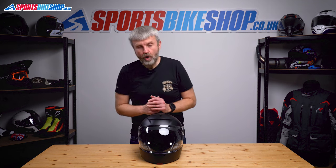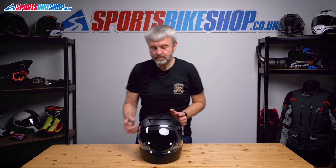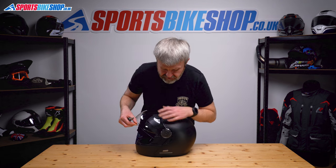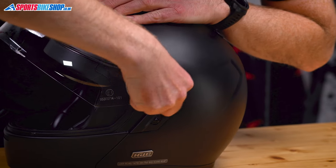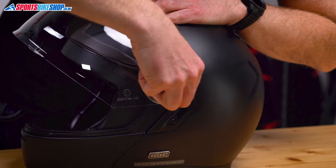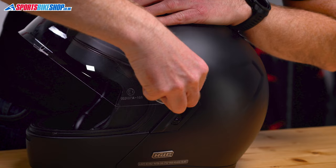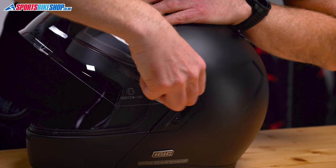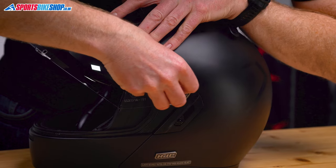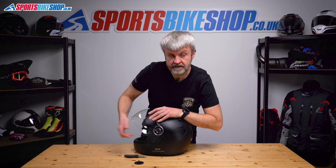The V90 is nice and old school when it comes to fitting the visor — no need for any proper tools for it. First job: lift the visor and then just unscrew this plate that holds it in place. Turn it in an anti-clockwise direction, or to give it a technical term, lefty loosey — spin that round until the plate comes clear. Set that to one side and the visor comes away.